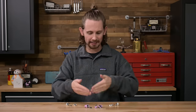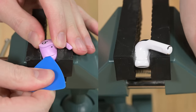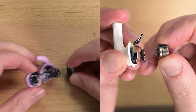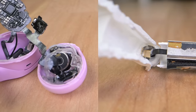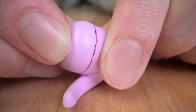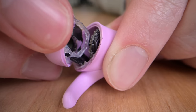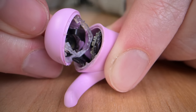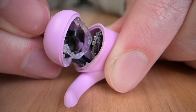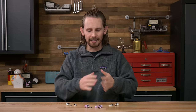To wrap this up, let's get back to the buds. Neither is a walk in the park when it comes to repair, but the real bummer is that even though both of these buds have relatively accessible batteries, you'll have a hard time putting either one of them back together. You can try smashing the two halves together, but they won't stick unless you were extremely careful opening them to save the delicate inner edge of the case, and even then you'll have to painstakingly remove the old glue and replace it with new glue.